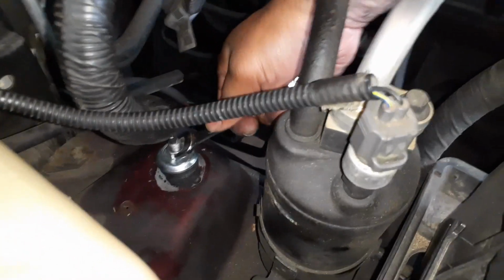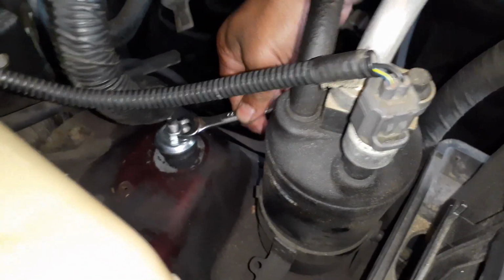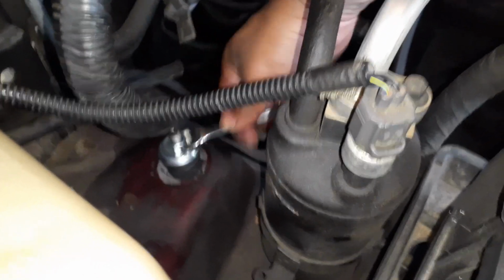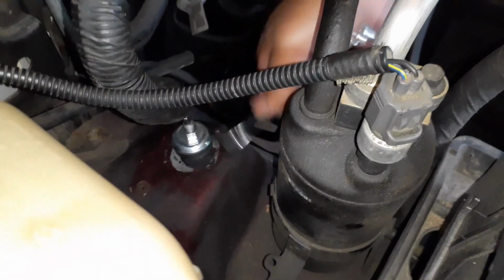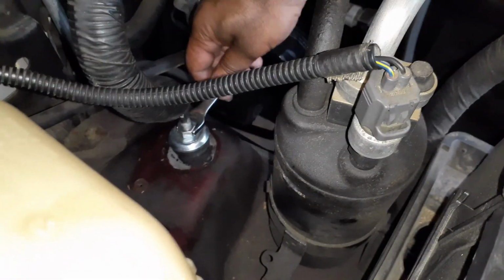One thing is, if you want to replace the shock, unless one of your shocks is bad, but with age, in my case, if I'm replacing, I should replace in pair. Otherwise the new shock will get too much weight on it when you are driving. So it's always recommended to do it in pair.